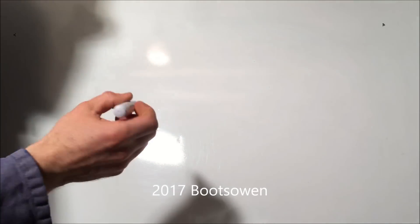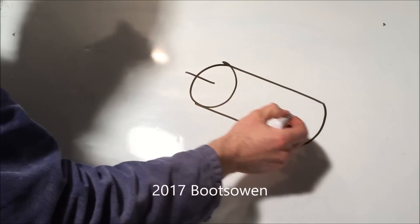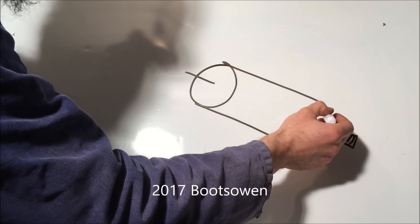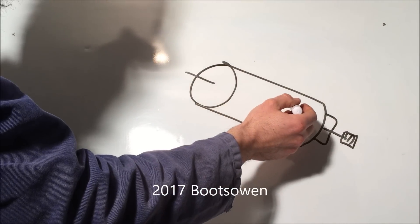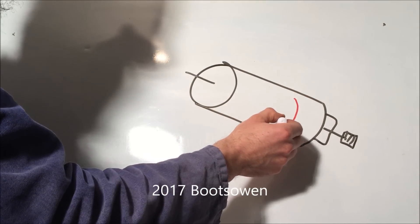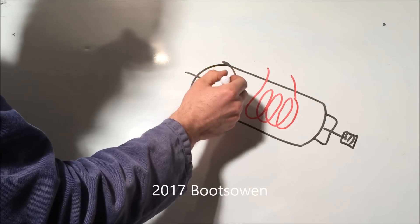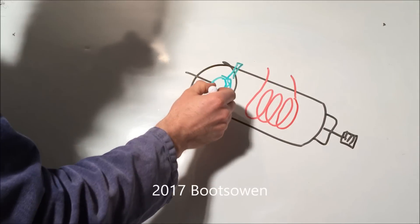On the right hand side we've got the two brushes, and the red and the brown go to the windings. So what's going on: we've got a motor, a shaft going through it — one end there will be a pulley, and on one end or the other there will be a tachometer with two cables coming from it. Inside here are field windings, and on the shaft is a commutator ring on which act two brushes.